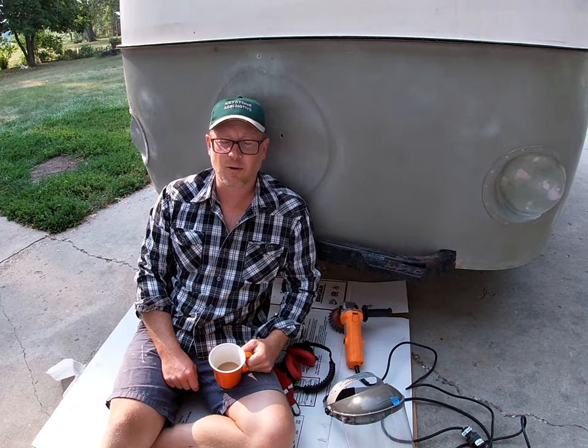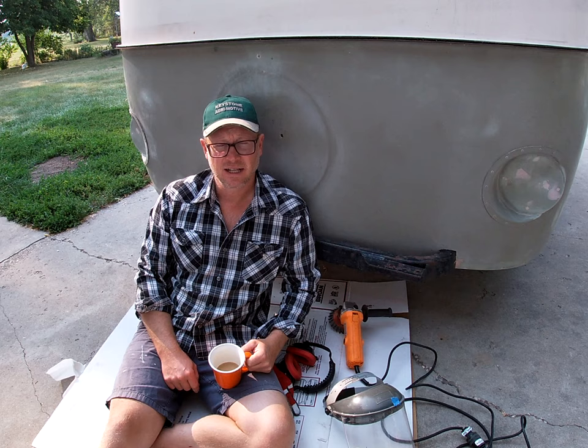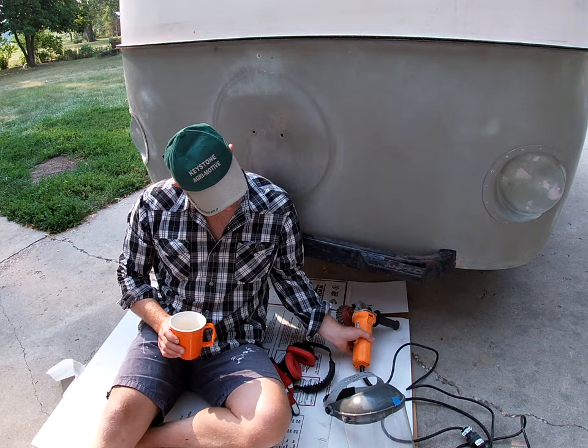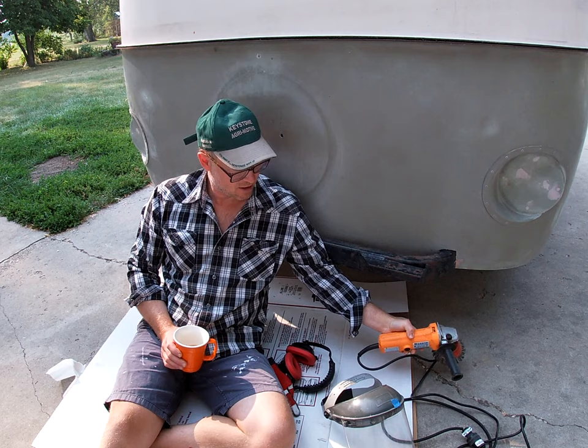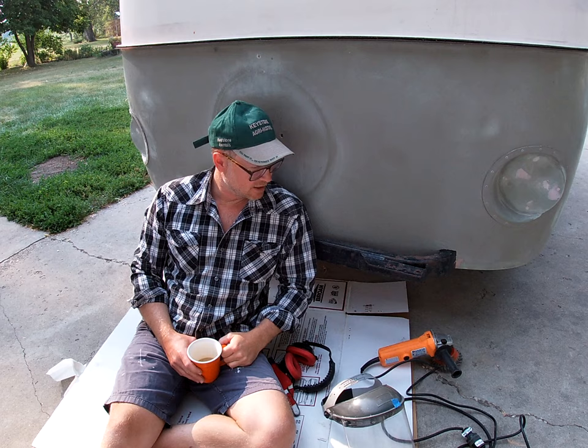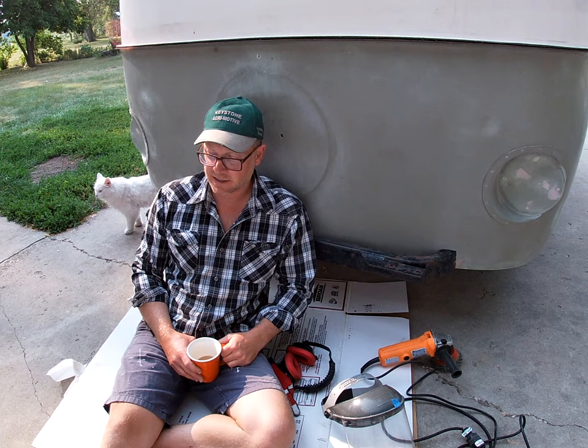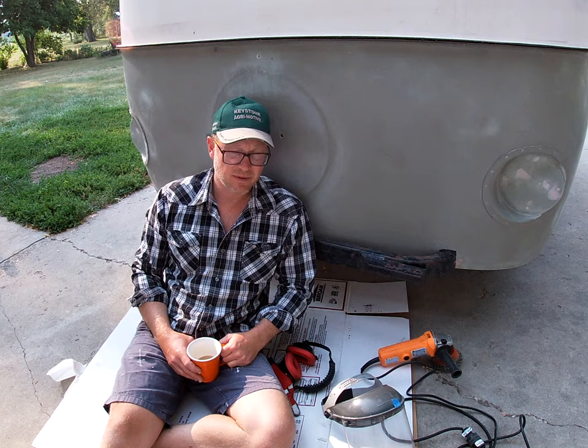John Bollerman here, leader of the Bowler Boy Party of Canada. It is day 7, 9:30 in the morning. We have to make up some time for our half day in day six. So what we're going to do is start grinding off the rust with a wire cup brush off the frame — not doing a full removal, just going underneath to knock down the big stuff, then paint it with some black oil paint. We'll also work on the kitchen cabinets inside the garage and try to get it primed on the inside. Should get lots done today — let's give her.